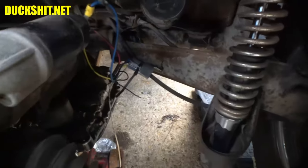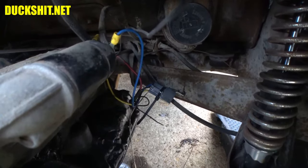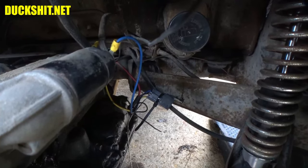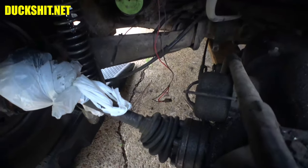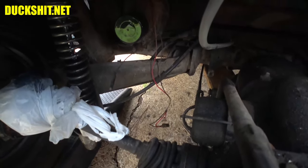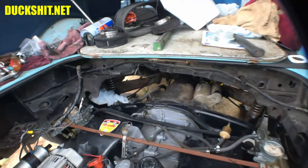The wiring over here is one white wire dangling down — that's actually the ground wire to the hot start relay right there. I'm not too keen on where that's at and I still may relocate it. This is a Type 3 and I don't think it has the red wire running underneath the back seat the way a Beetle does, so it may not be easy to relocate there. We also have that stray wire, which I'm beginning to think is for the cylinder head temperature gauge on the dashboard. There's no sensor on it — the sensor seems to be missing.